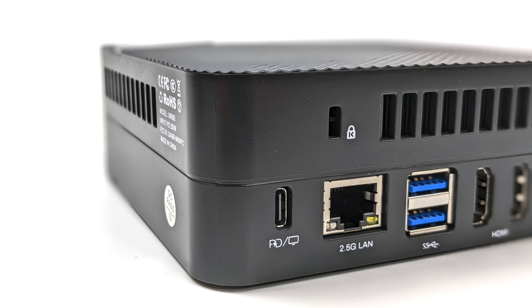The UM580 comes included with a 100-watt PD quick charger. It does take a lot more power than the UM560, because this is actually using an H-variant APU — the Ryzen 5800H. For my testing so far, I would recommend at least 65-watt input from your display. A lot of older monitors with Alt Mode only did up to around 35 watts, which is fine for the UM560, but since we have the 5800H here, this will be pulling more power and putting out better performance.